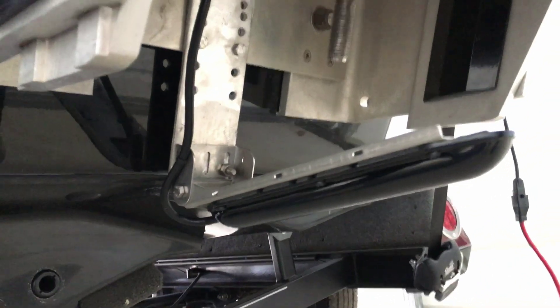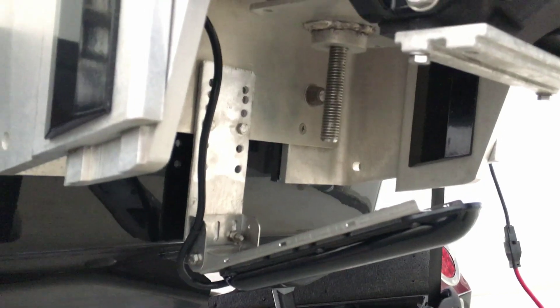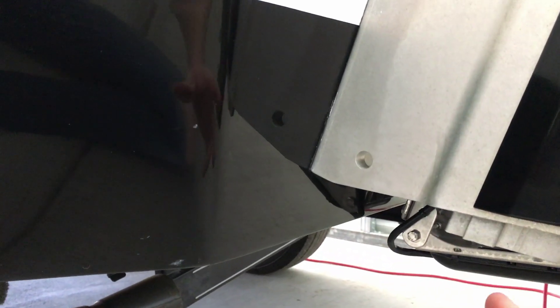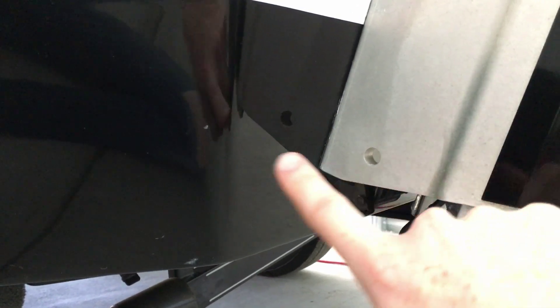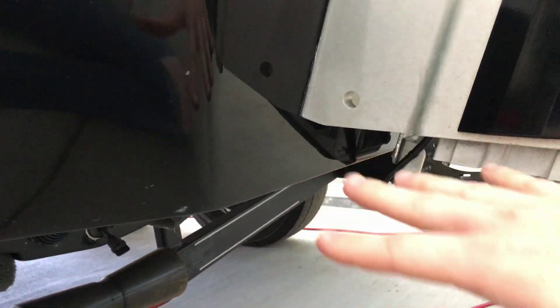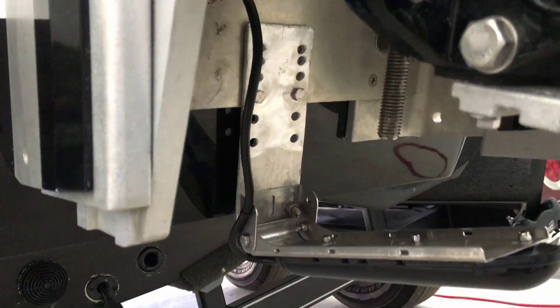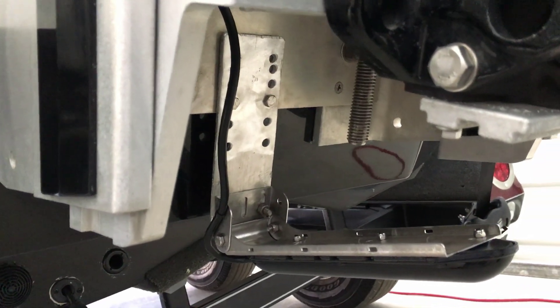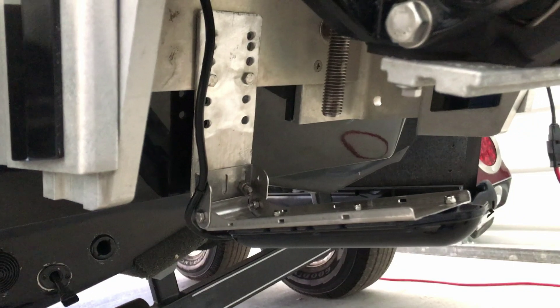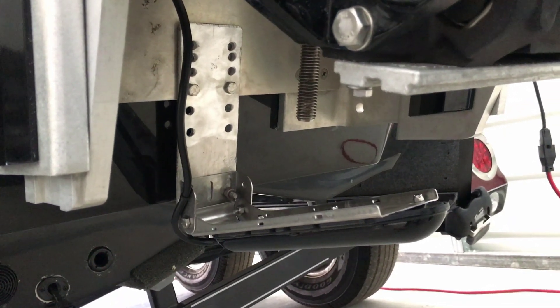So that's the setup that I used — very simple. It did take a little bit but I think this was a good option. The other option I had was to use this hole right here on the side of the jack plate. I was actually going to run a large bolt through here, have the bolt come out, and then drill the mount for the transducer so the transducer would mount right here with a kind of spacer and tighten it down. The reason I didn't do that was because I felt like the bottom of the boat or the jack plate might be in the way a little bit. I like this design better because it's more adjustable, but I have heard of experiences where people have had echoing within the jack plate, so I have yet to do a ton of testing. After this I'm going to cut to a video of me actually using it on the water so you guys can see what it looks like with this mounting configuration and what kind of results you will get.